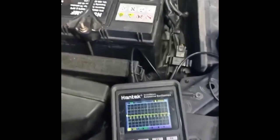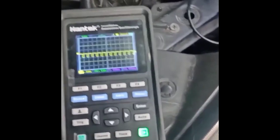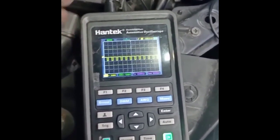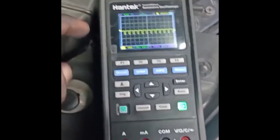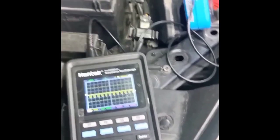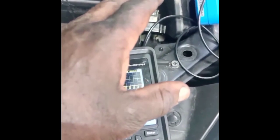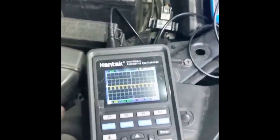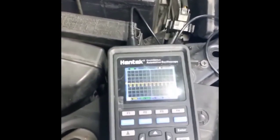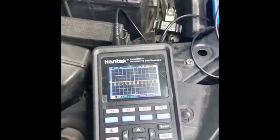What I'm doing here is verifying that the coils are getting the proper signal. You can see the on and off, the high and low signal waveform — I hooked the clamp to the ignition signal, so I know I'm getting a good signal from the ECU to the coils. Still have to double-check whether the coil and plug are good.